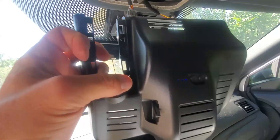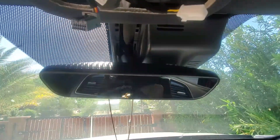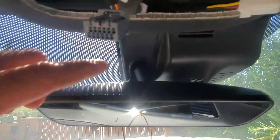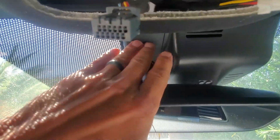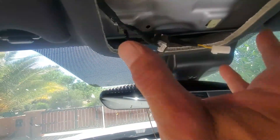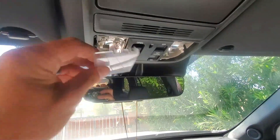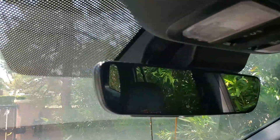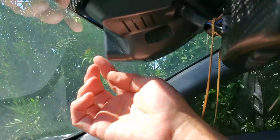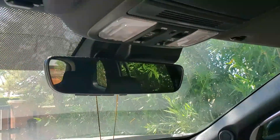Once you have the wire for the camera connected, you're going to pull the little plastic cover off for the opening for your rear view mirror and slide this up in and clip it in place. Once you get all the wires neatly tucked up inside and this piece clipped in, the last thing you're going to do is put the little plastic plate over the opening. To get that little clip in, just tuck it down under the hooks and push it up until it clicks. Then reinstall the three connectors back onto the dome light assembly, tuck it up, and put the four screws back in place. There it is fully installed — it looks very much like the regular setup except for a bulge coming out here, which is your camera. There's a little piece of plastic film on the end that you need to take off as well.